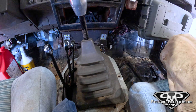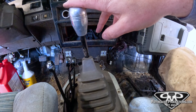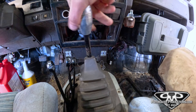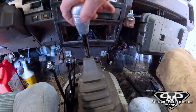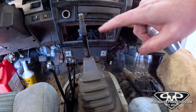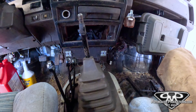Something else I see mentioned all the time is how to take off your Nissan shift knob. This is an aftermarket one, but stock ones are the same thing. They just get put on with a little bit of Loctite, so just twist them off. If you're struggling, twist harder — all it is is a spline shaft in there. Never buy a metal shift knob — it's really cold in winter time.